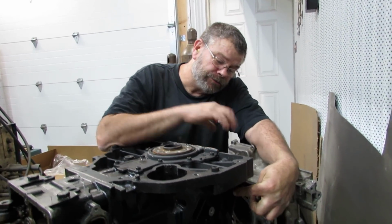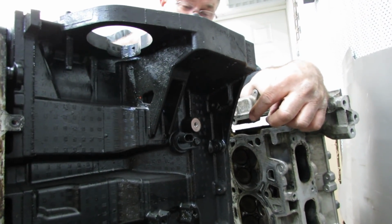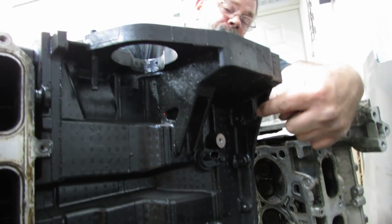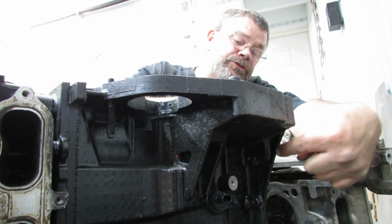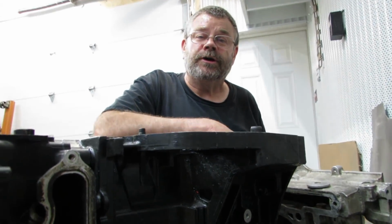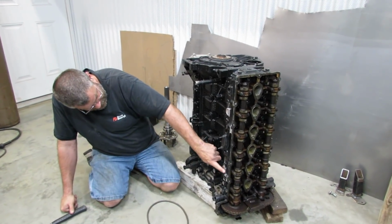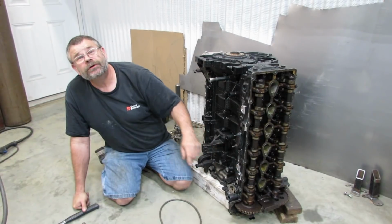The oil pan that gets modified is a five-cylinder oil pan, which has a rear sump. The six-cylinder has a front sump. So what we'll do is we'll clearance this area so that the new dipstick hole can go into the five-cylinder sump. Cool. So, yeah, I'll just have Calvin weld that all up.